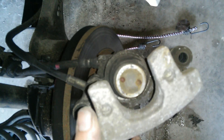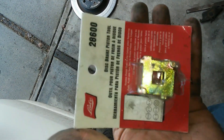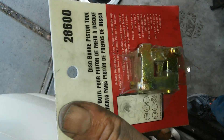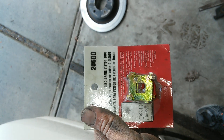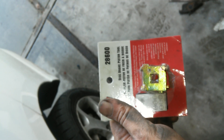The trick is compressing the piston. This is one of those push-and-turn kinds — you have to have a special tool to go down into those two pins. I picked up this tool from O'Reilly's but it didn't work. It's supposed to be a half-inch drive, which is fine, but it's got these little nubbers on all of them to fit different pistons and none of them are spaced properly — they're all too big. In the end, I just ended up using a bar and needle nose pliers.